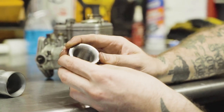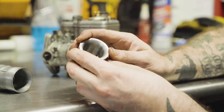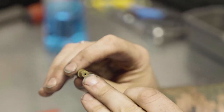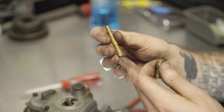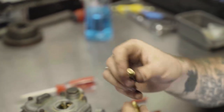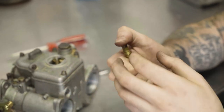So with these chokes, the starting point for a main jet should be somewhere around 120 to 130. At the top of your main jets, where your air correctors are, that's going to be somewhere around 40 or 50 over in size — that's the diameter of your air corrector. So let's say we're looking for something around 130 and 170, maybe 140 and 180, depending on how rich you want to run and the given mods on your car.